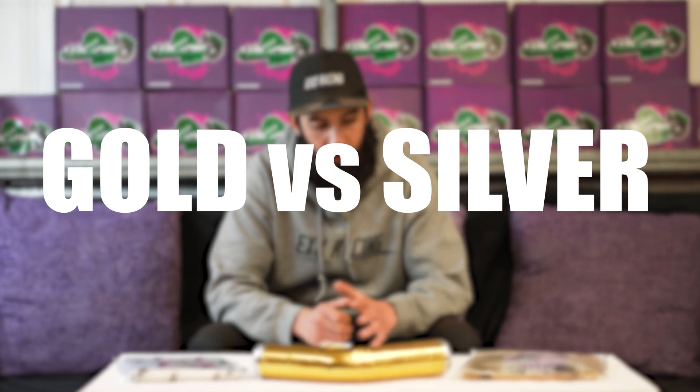Now, gold versus silver reflective. A lot of people think gold is massively better than silver, but in reality it's probably a five to ten percent difference. In a road car you'd barely notice — it's so marginal. At high horsepower drag cars running 1500-plus, the five to ten percent scales higher and matters more. For most people, it's really just about which color suits their engine bay. Gold does reflect slightly more heat, but unless you're in a massively high horsepower situation, go with whichever you prefer.